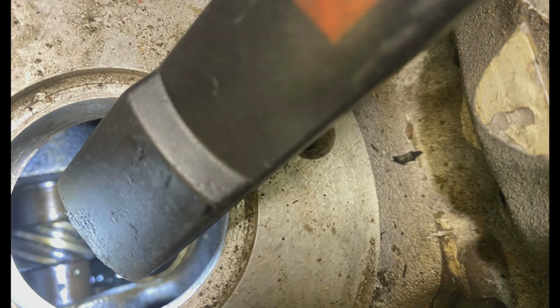So I've looked at a spare engine and another V12 as well. On that jack shaft in the middle, there is a little sprocket at the end for the distributor drive gear to go onto as well. And that has a pin on it to secure it. And when the engine is timed, that pin points straight up, so you can see it when you look into the hole where the distributor sits. So that's what I want to see right now.